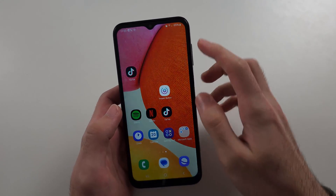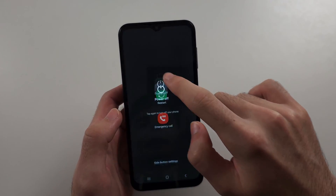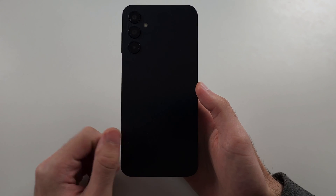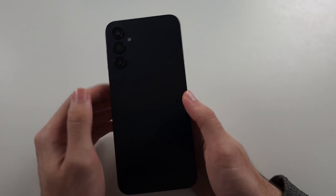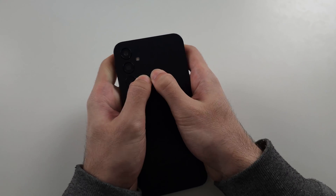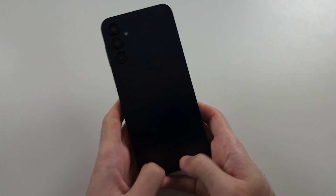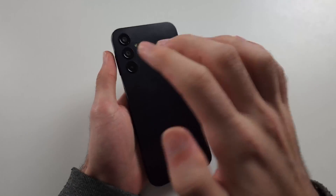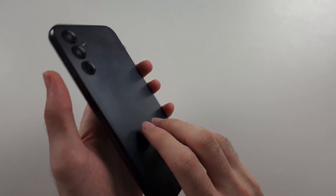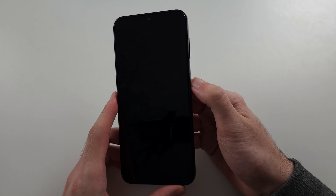If it is your phone at fault, we're going to power off the phone. The Wi-Fi antenna cable may have unplugged from the phone, which is causing problems. So get two fingers and press with maximum force all the way around the back of the phone — push as hard as you possibly can. Then get two fingers and tap with maximum pressure all the way around the back and front of the phone. Spend a good five minutes on this. This would hopefully put that Wi-Fi connector back into your phone.